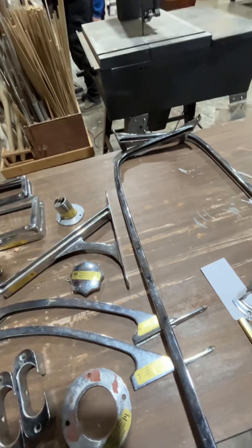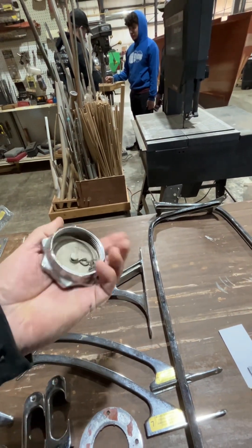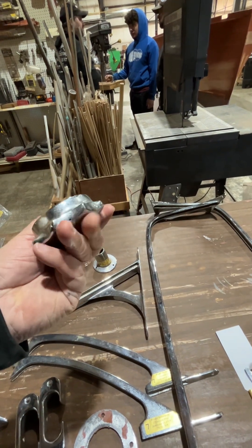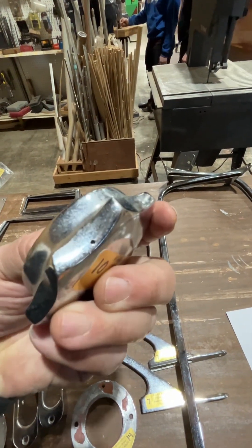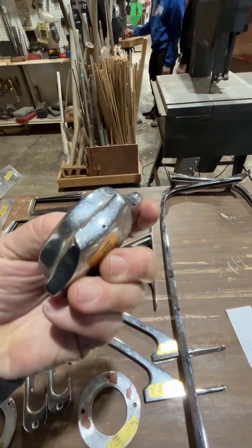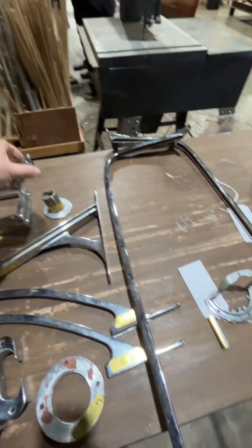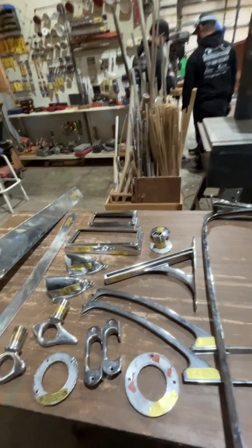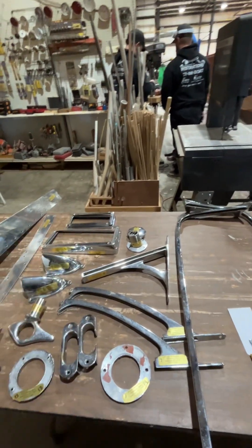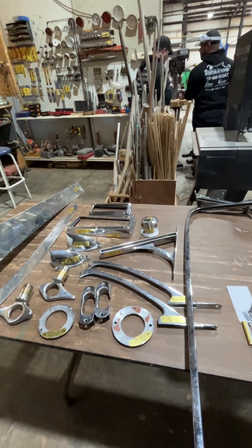This is a star gas cap. Your boat - you see this little hole right here - that was your fuel tank vent. So we're going to vent your fuel tank that way. We ended up replacing the plank that had an improper vent in it, so this will be how we're going to vent your tank. We'll plug the vent line off on your tank.